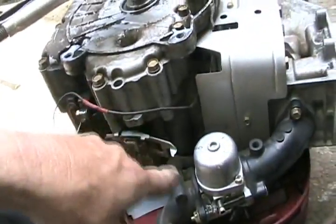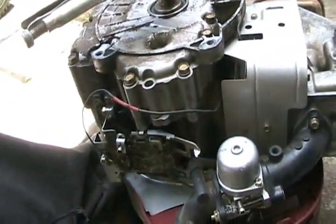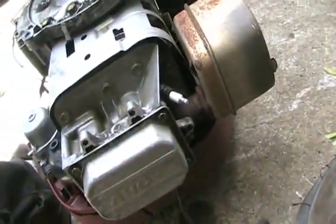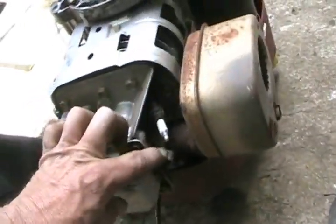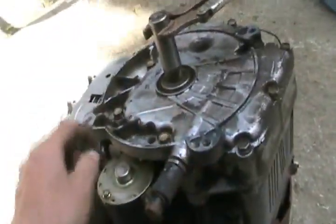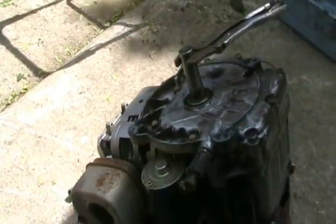I've already checked the sides of the crankcase on both sides — it's not cracked or blown out, so we have potential to repair this motor. First thing I did was remove the spark plug and check it wasn't hydro-locked with gas or oil. I hope you check that first, always. Now just remove the perimeter bolts, pop the cover off, and let's see what's happening.